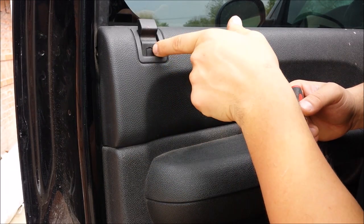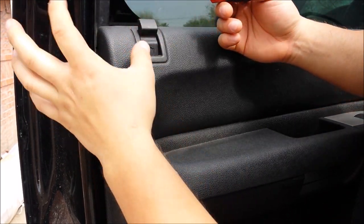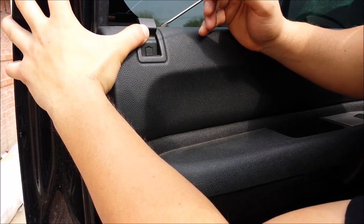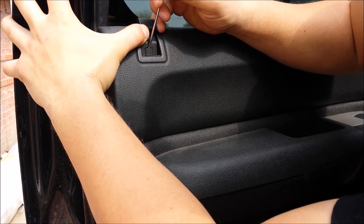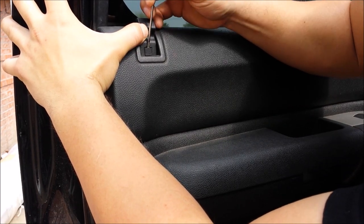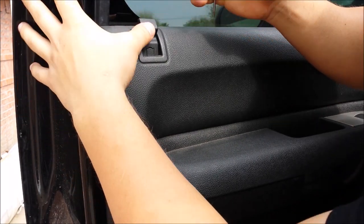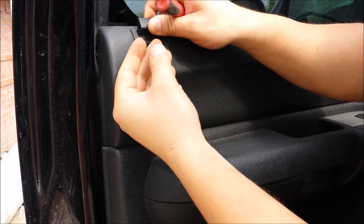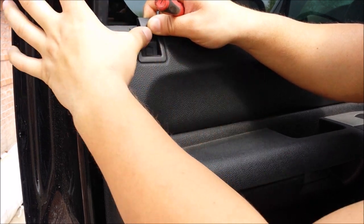The first thing you got to do is remove this little lock. You can use a small little flat head screwdriver. There is a notch right here and you place it in there and you kind of try and stab it in while at the same time prying out. You also have to hold this lock up because at the very bottom you need to leave that exposed so that little square can pop out.